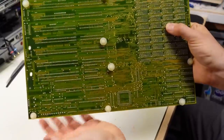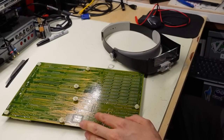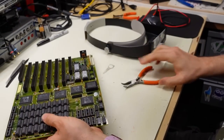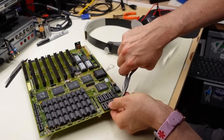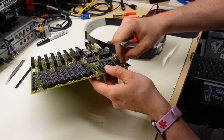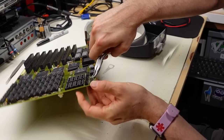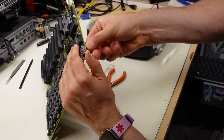One thing I need to do before we start is this motherboard still has the case standoffs in it, and I hate working on a motherboard with those installed, so I'm going to pop those out right now. I'd love to hear people's tips and tricks for a good way to get these out. The way I've always done it is grab needle nose pliers and just squeeze and try to get these out — it's always a little fiddly. Some motherboards have holes that are a little under spec. All of these are just copies of IBM's 5160 and 5170 motherboard from a form factor perspective, and this motherboard appears to have holes that are a little bit too small.